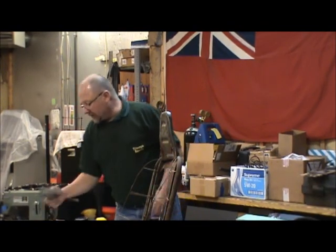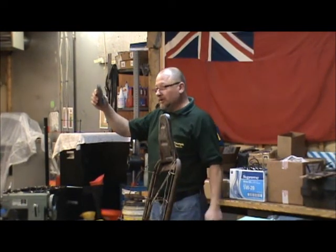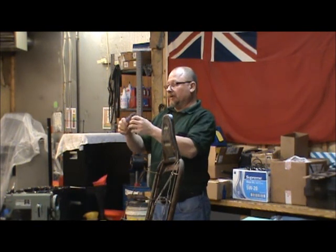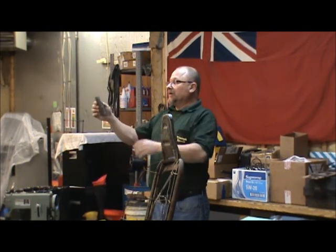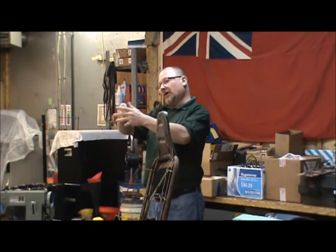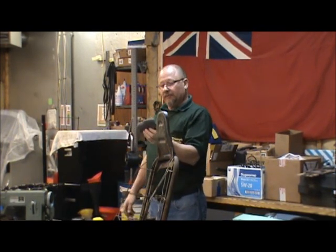I like to use a 3/0 steel wool on chrome bezels, gauge bezels. You can go around the edge there, and a real soft steel wool, like a 3 or 4/0 steel wool. You can actually clean glass with this stuff. Chrome, it's so soft, and it just pulls off whatever is sitting on the surface. Great stuff.